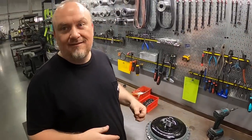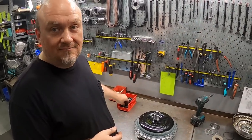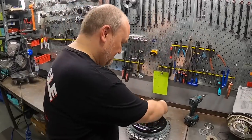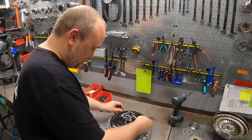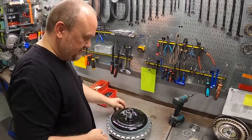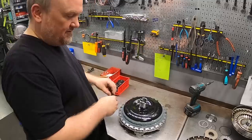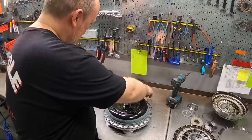It's more just like if you're at home and you see a cheap stator online, I'd assume this is probably more information for the used converter market. Like if you picked up a converter off Yellow Bullet or something online, picked it up cheap, and it's not quite what you're after, and potentially you can't even identify the manufacturer. You go and grab a stator online and go, oh yeah, this might work, and try and throw it together. Yeah, you're in for a bad time. It's a guaranteed bad day almost 100% of the time. It's a good chance of a bad day.